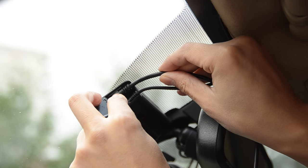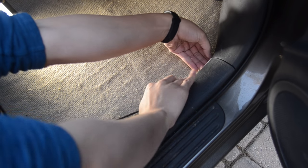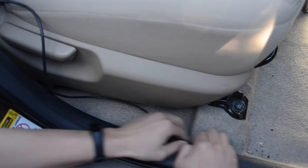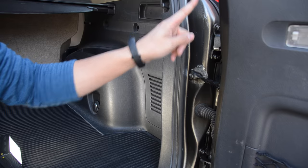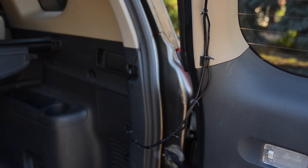Next is the rear cable. Each car is different, and you'll probably want to run it next to or under your seats for the easiest installation. The cable is thicker than most, which is good for durability, but can be a challenge in tighter spaces. If you get it professionally installed in a hatchback, you may not have room to thread it through rubber connectors. I left mine in the open, but it worked well as I kept the wiring clear of the hinge.